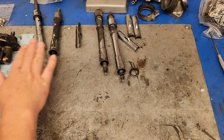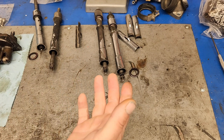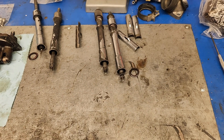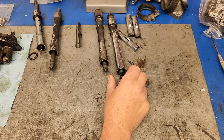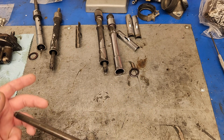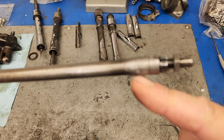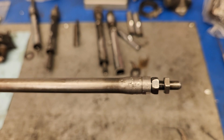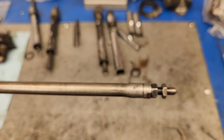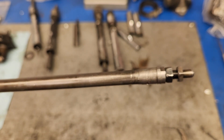You can see I got my push rods all up here — they're in push rod tubes and they're all in the order that I removed them, because originally I thought I'd just be reusing those. But the first thing that I noticed when I lifted the covers off was all these chew marks — you can see all these chew marks where somebody put some pliers or something on there and really muffed those up. That did not make me happy. They're all like that. So that was really disappointing.